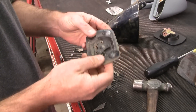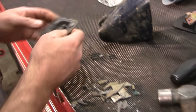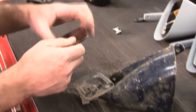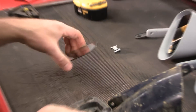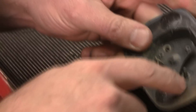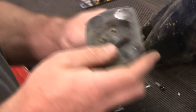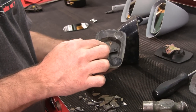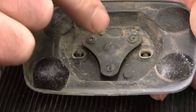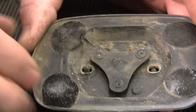Notice the original glass is only held in by four little daubs of silicone. Our replacement mirror comes with double-sided adhesive tape — that's a great way to do it. Or you just roll this off with your thumb or get a screwdriver, scrape off that silicone and use silicone again if you want to be a purist. Sometimes you'll see everything's intact here, it's just this pivot has become worn. We're going to have to get inside that joint to do some work, so let's go grind these peened-over studs off.